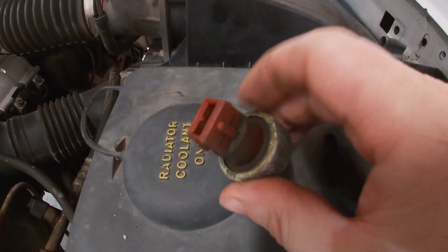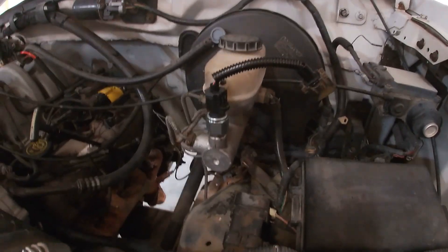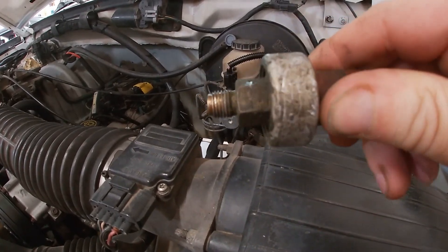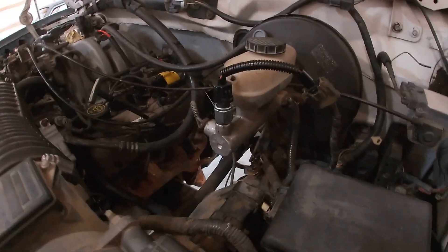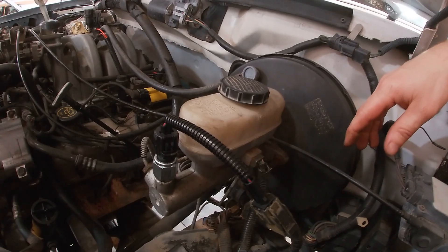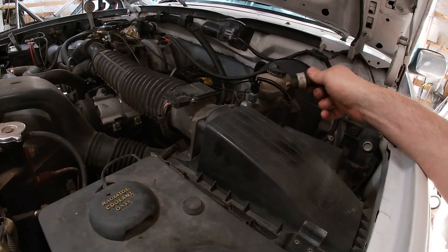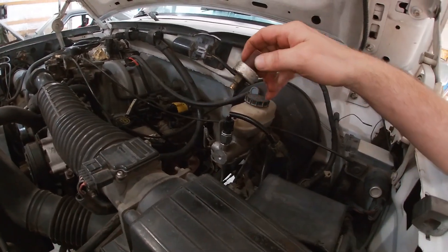Here's the old part — you can see how it's been leaking brake fluid. It goes right there — the nut for it is right there. Mine's nine-sixteenths, that one right there is seven-eighths. Just put it on right quick — done. I may clean this up, I may not. But it took me longer to figure out what this part was called and where to get it than to change it. I mean, you just have a little bucket or rag — it really didn't leak all that much fluid, it seeped a little. Just change it — super easy.